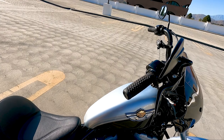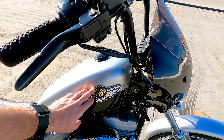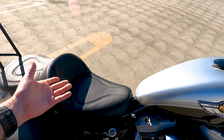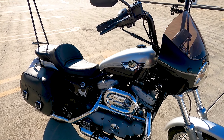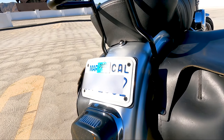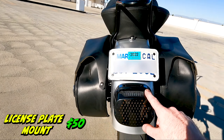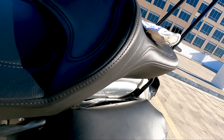They blink pretty fast because — did I even mention this is a 2003 originally 883 Sportster, the anniversary edition? With the LED turn signals I did put flasher relays under the seat. I made a video on that, it's been working great. You can change the speed on them so I pumped up the speed to make it flash a little quicker. I also have a lay-down license plate — no lip around the outside — only about 30 to 40 bucks off Amazon or eBay.